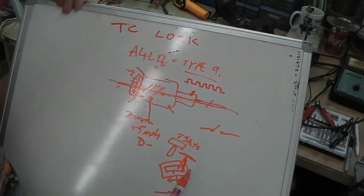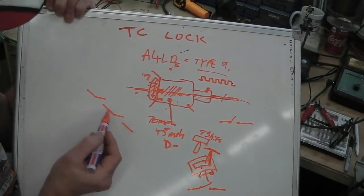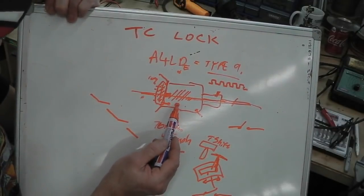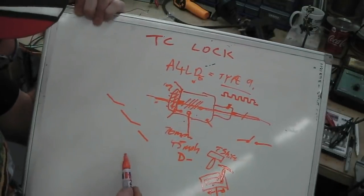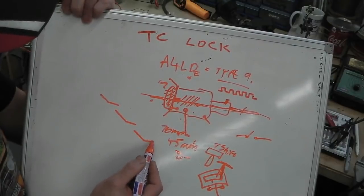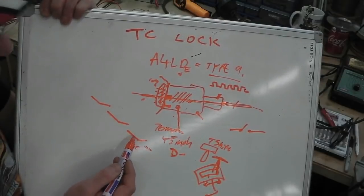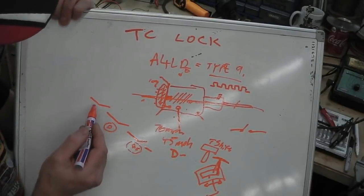So we've effectively got what's called a string of events that have to all happen together. So one switch has to be closed, goes through a second switch, which also has to be closed, in order to allow the current to get to this 12 volt solenoid here that will open the gate for the valve, let fluid in and create force on these lockup plates and lock the system up. So we've got that brake pedal, position D on the stick, and also we need it to be at the right speed of 45 mile an hour. So any one of those breaking will knock it out, and that's called a string. Each switch has to go through the next, so they all have to be closed. So we need a speed switch, we need the drive position switch, and we need the brake switch.